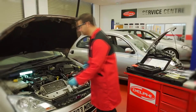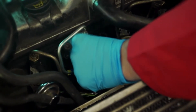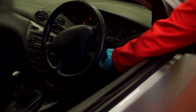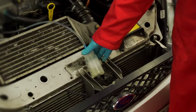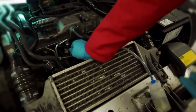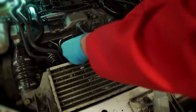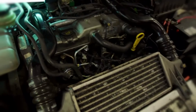Connect each electrical injector connector and then start the vehicle. With the engine running, collect the fuel in the back leak collectors. Stop the engine, reconnect all back leak connectors and remove all test equipment.